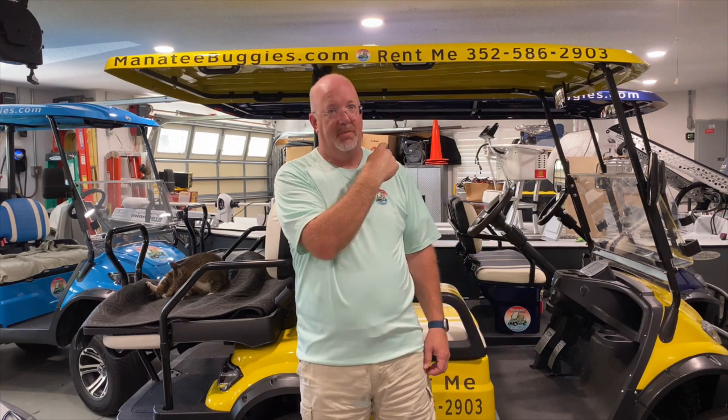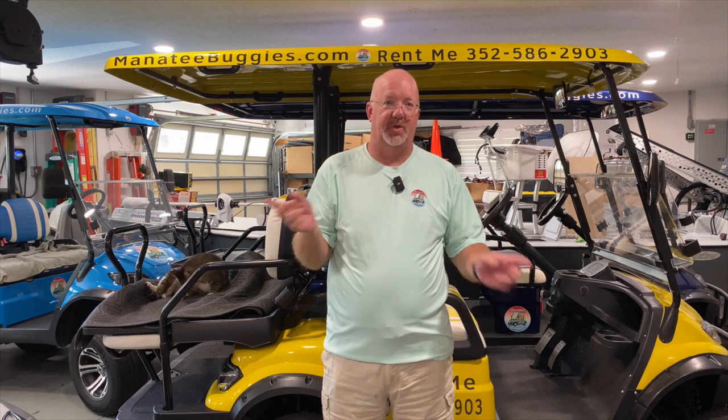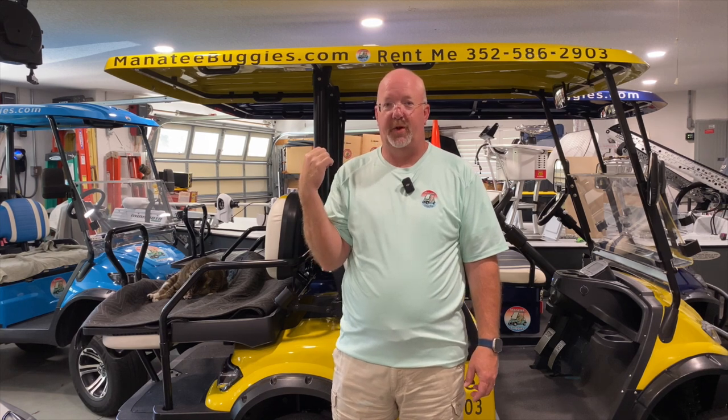Thanks for tuning in. We had an electronic brake failure on the I-60 behind me, and we did a switcheroo between the motor assembly, the entire motor assembly from this I-40 to that I-60. So what we have left is the I-60 motor with the bad electronic brake on it, and we're going to disassemble that and replace it with an upgraded model. That hopefully will resolve any future issues with this unit anyway.